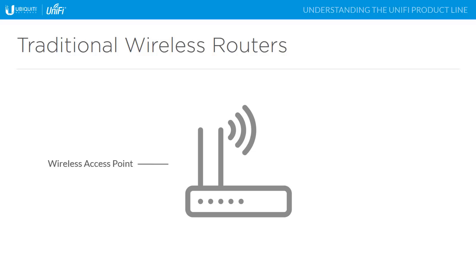So obviously it is a wireless access point. They're usually also a switch, and they'll frequently have multiple Ethernet jacks on them as well. This one device also acts as a firewall, and of course it provides an administration interface. So you see how this one unit does everything. Sits in the one spot in the house, does Wi-Fi, switching, firewall, admin.